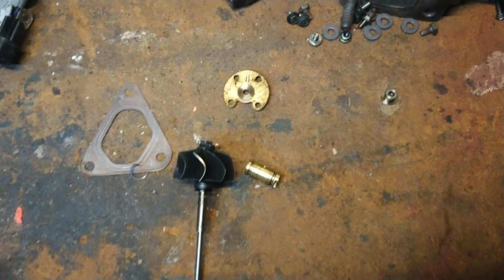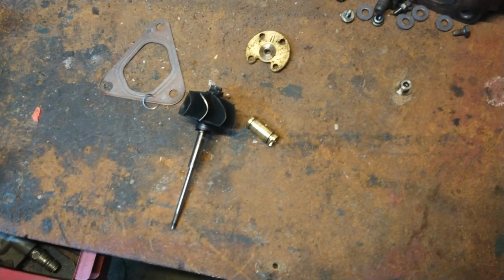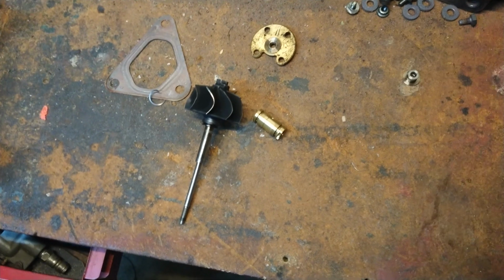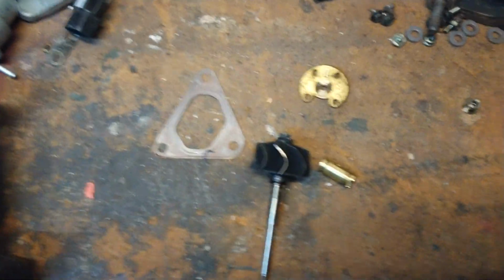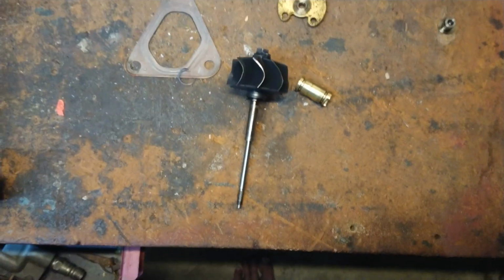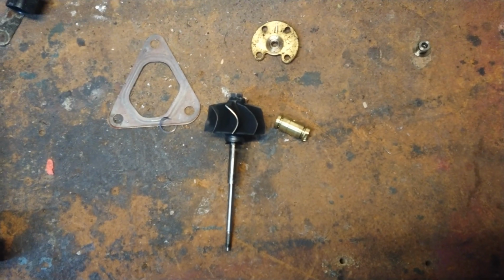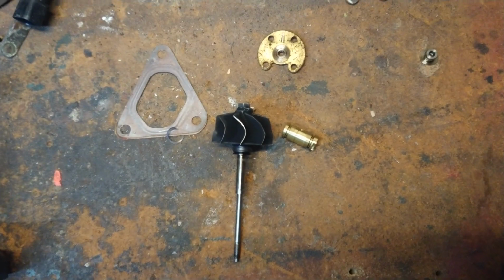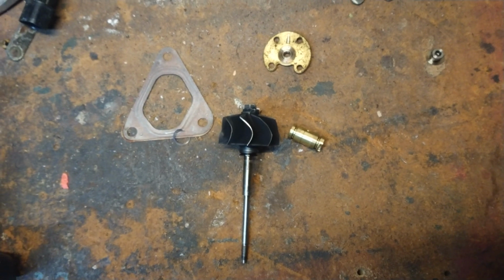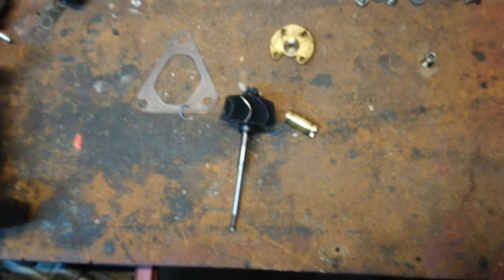It's funny that the vanes are pretty complex if you're going to take the entire system apart, and rebuilding the turbo is not even as complex as dealing with that vane system. I did clean it up as best I could. Pretty much serviced the whole turbo itself, and got that straightened out. I haven't cleared any codes, but it's running pretty consistent and pretty strong, no lag.